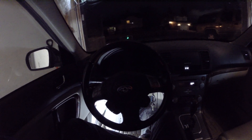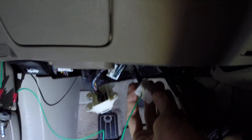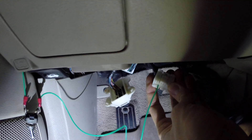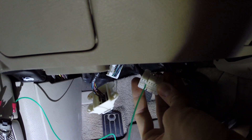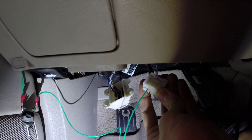Hello, this is test start number three of my 2008 Subaru Outback 3.0 R. This time I still have the transmission control module disconnected, except instead of a jumper to the ground pin, I have a wire going to a switch which then runs to ground, so I can turn the ground pin on and off — that's pin 55, pin 11, which is the neutral start switch.